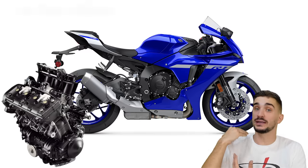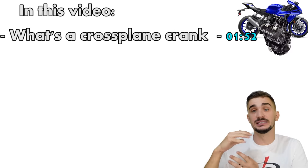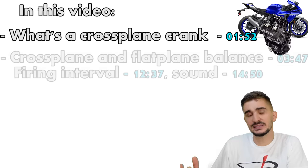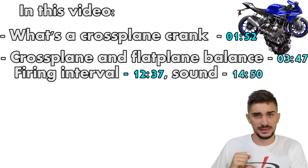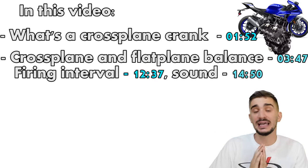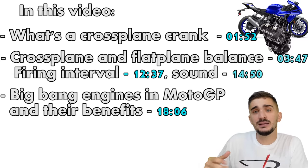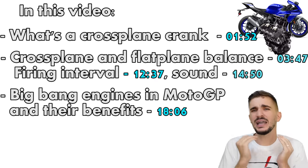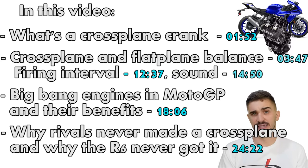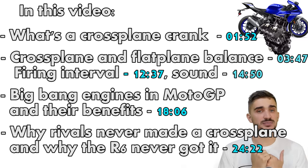We're going to explain what the crossplane crankshaft is and how it differs from the flatplane crank. We're going to see how this influences engine balance and how it explains the different soundtrack produced by the Yamaha R1. Then with all of this in mind, we're going to take a look at the history of big bang engines in MotoGP and what benefits they bring to the table in the real world. We're going to end the video by seeing why other brands never adopted the crossplane design in their production bikes and why another fan favorite from Yamaha, the R6, also never got a crossplane crank.